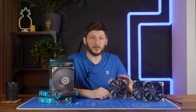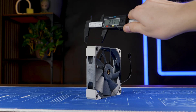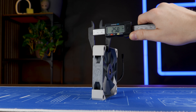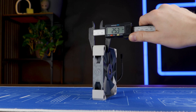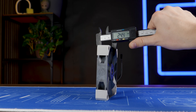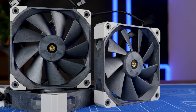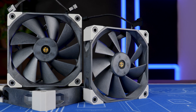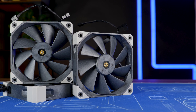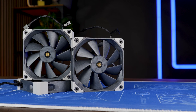Something interesting is that the fan is not actually 25mm thick like 99% of fans out there. The 25mm of the Griffin actually comes from the rubber corners, which protrude quite a bit. If you measure only the fan frame, you'll end up with about 24mm — which is not the case, for example, with a P12. Another highly interesting point is the blade design: this one comes with nine slightly bent wings which are almost flat. Compared to the A12X25 and T30, this is not the usual route — the Griffin actually shares more similarities with an Arctic F12 or Noctua F12, which is okay, but interesting.